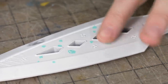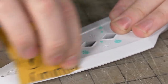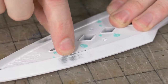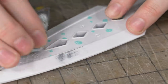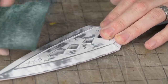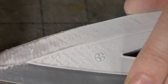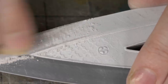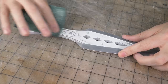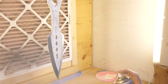I waited about another half hour for the filler to dry, then went in with 400 grit sandpaper to sand it smooth. I'm using wide cross-strokes so I don't create a divot — there should be just a little bit of green left in the hole. I go over all the filled spots and sand them smooth, then give everything a buff with a scouring pad. I want to hit it with one more round of primer, but first I'll do a bit of sanding on the other side with 220, then 400, then the scouring pad before one more round of priming.